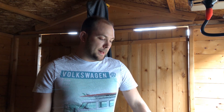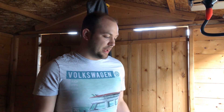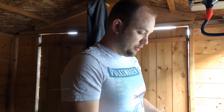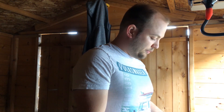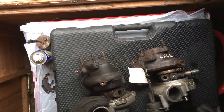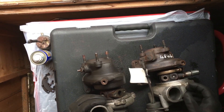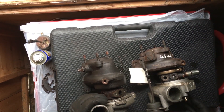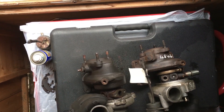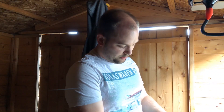We may even look at changing the intercooler as well - probably get a second-hand one from maybe an Evo or potentially a Cosworth. I've noticed there's a slight difference in the up-pipe as well, so we'll take a look at that and see if it's going to affect things much. If it does, we can change the pipe adaptations - it's not a big deal. I've got it on and I presume it's the same size - yeah, it's the same size, so we'll be absolutely fine there.